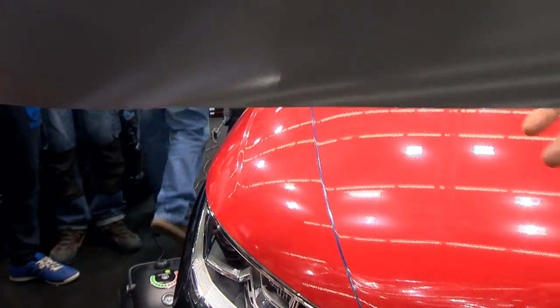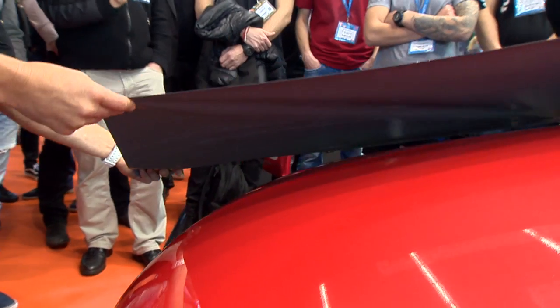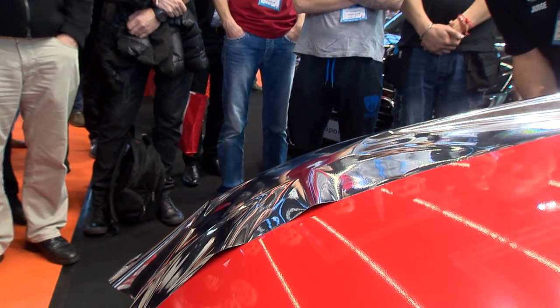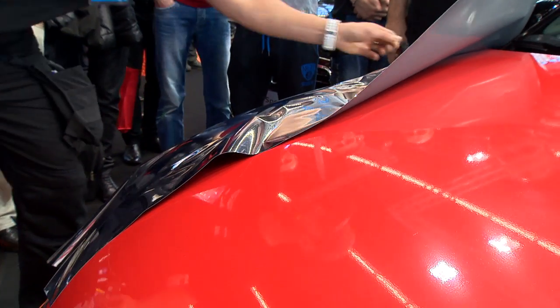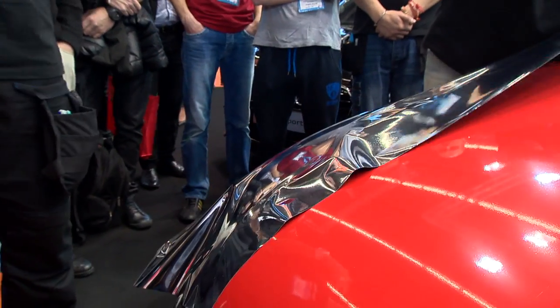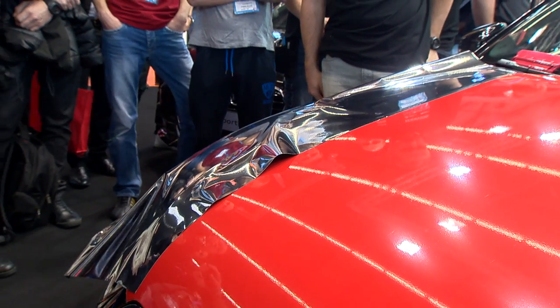And then John's going to get it into position, right to here. And I get it close. I think we need to do it at like an angle. So we do it here, because the only thing that's hard about chrome right now is it's 120 centimeters wide, all right? So once we lock it, the trick is, all we're going to do right now is kind of lock it in right there with my thumb, and that's the last we're going to squeegee until we get it on, all right? So now we have it set up here.